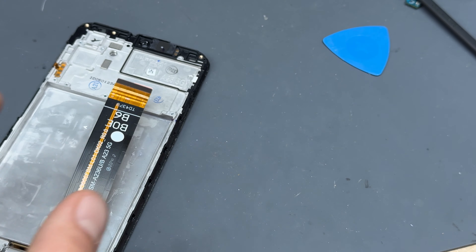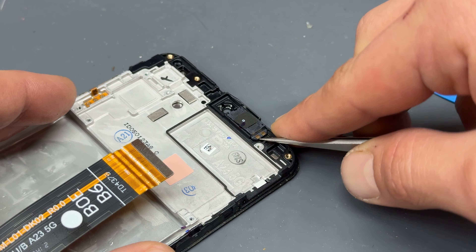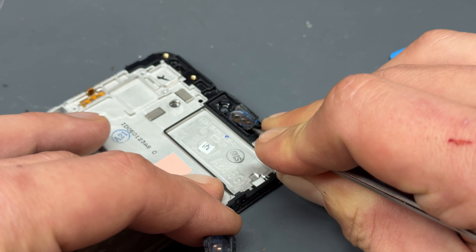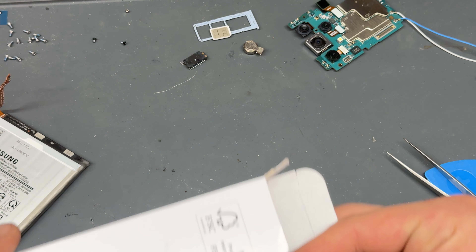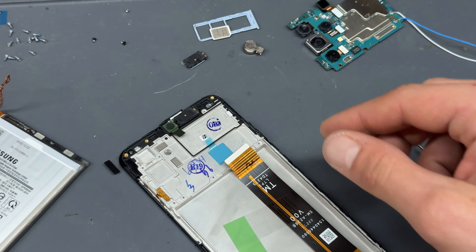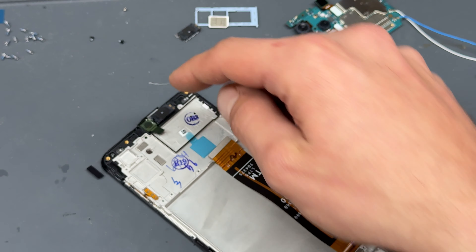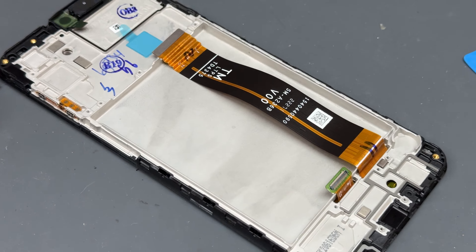With the battery removed, the final thing that we need to remove from this old chassis is the ear speaker, and that's the same as the vibration motor — there's a little spot just here underneath the bottom pin that we can get the tweezers underneath and gently pry it upwards. Once everything's out of this chassis now we can put it to one side for recycling and then we're going to get our new part, which is a genuine Samsung service pack. I will try and remember to leave a link in the description below. I've just noticed as well that this does actually come with the ear speaker attached, so just check that yours does.